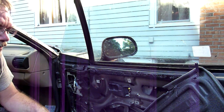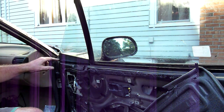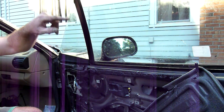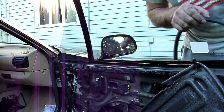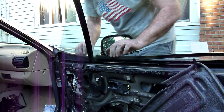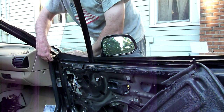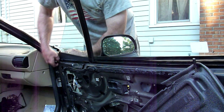We are so close to being done. Now we're going to put back in the outside weather strip and then the inside weather strip. This is a good time while everything's out to clean the windows thoroughly before greasy hands are all over them. Now we're going to put the outside weather stripping back on. You've got to make sure you line it up in the opening the way it belongs, close underneath.